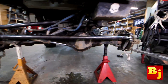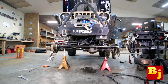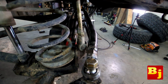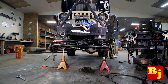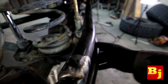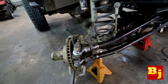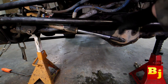Everything's tack welded together now, I just got to check clearances. Clearing here just fine — it's pretty tight up here but just a little less than a quarter inch, so we're clearing. We're clearing everywhere. Let's check the other way. Everything clears — still clearing up here just barely, and we're clearing down there. Everything's looking good. Now we can pull these off, finish weld around them, and then locate the collar for the mount on the hydraulic ram.